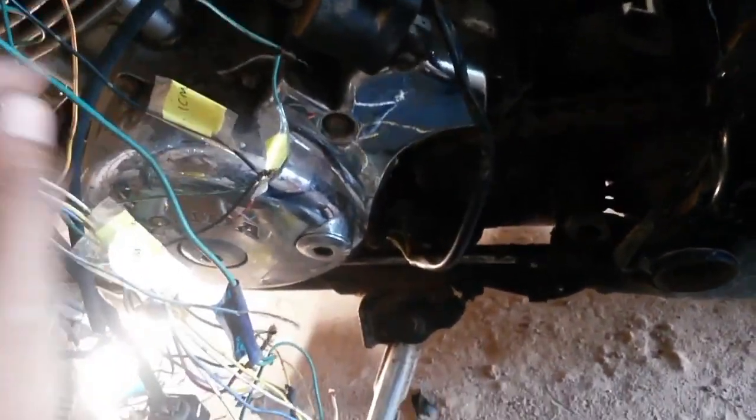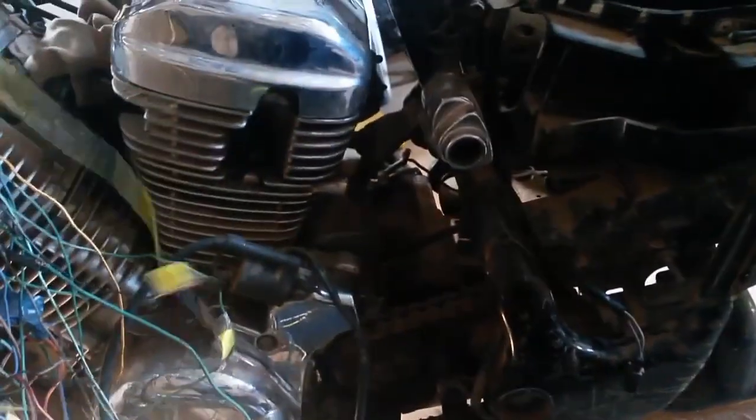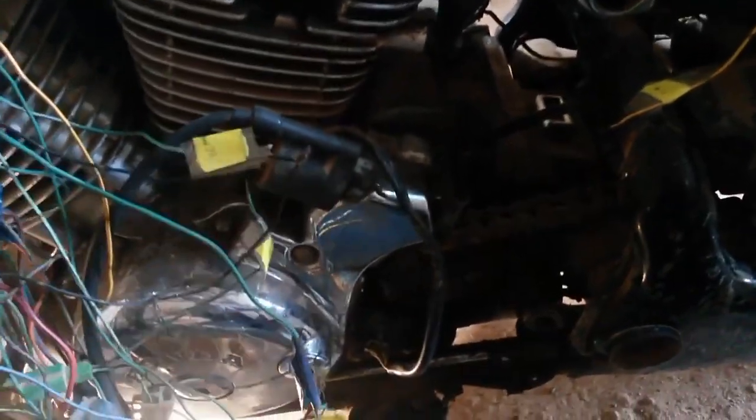All 10 of the ICM wires, all of these are from the pulse generator, all of them together. It's been pretty difficult because rather than just unplug things or even just cut and rejoin like they've done for some of the wires, for the ICM everything's just been cut out. And then they've cut some random wires as well and just left them hanging. The back ignition coil is completely, the wires were just kind of tangled inside. They've been completely cut off, so I'll put those there separately. One of them goes to the ICM.